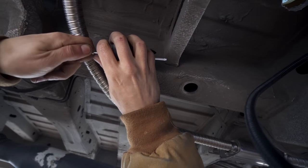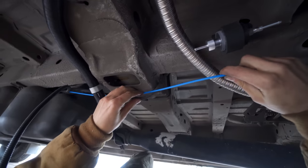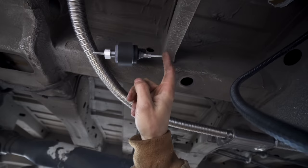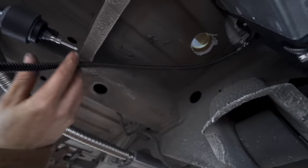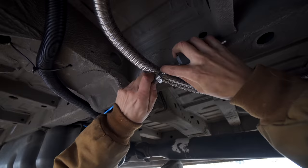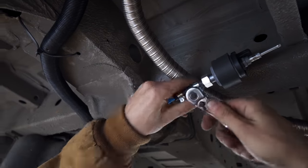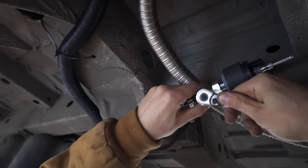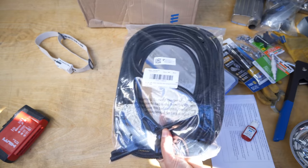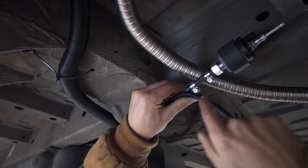This is gonna be our auxiliary fuel line. And, feed it in right there. And then here is going to be our main line feeding into the heater itself. Hose to hose. I'm tightening it down. But we're not touching here. That's good. Ready? And I also used some 1/4-inch split loom that I had to buy on my own just as an extra protector for the lines.